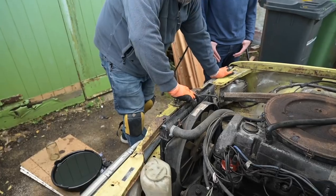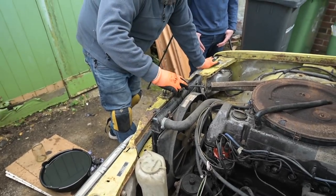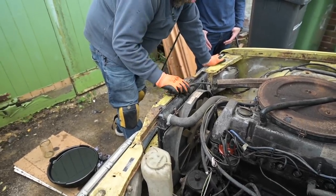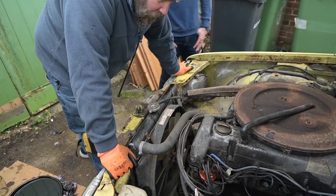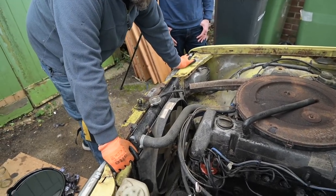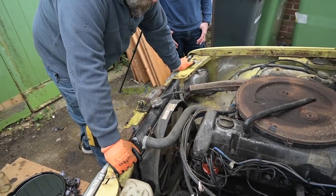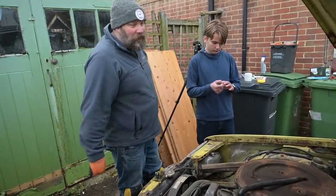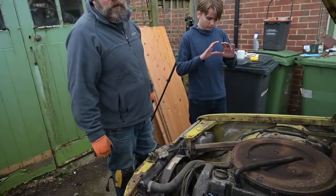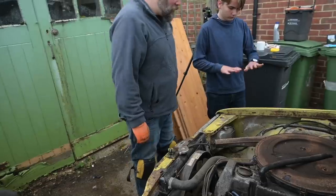New rotor arm. Yeah. I would say if it's got water in it at all, drain all the water out because if it freezes, that will crack your engine. And then just replace it with actual antifreeze. Yep. Because we don't know what was in there, do we? We have no idea what was in there. Because the other thing I need to do is clear out and get the sunroof sorted out. We can live with that for the time being. Yeah, true. Just don't open it.